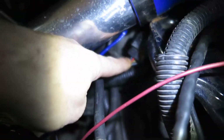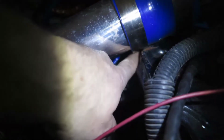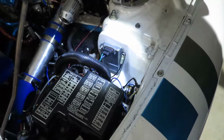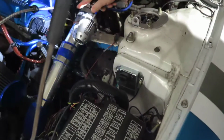The blue, on the other hand, goes all the way to the ECU, where the ECU was. In my case, I ditched that ECU. I cut that blue wire from the top of this connector and connected my wire that is coming in here. So here you see a blue and a green. The blue one, ironically, is the 12 volts, because it's the top of the triangle, and the green one is the one we are after. I cut the blue from the connector because I don't want it hanging in the engine and coming here to the ECU. I haven't gotten rid of all my wiring from the ECU yet, because I don't know what else I'll need, so I'll wait for the car to run perfectly.